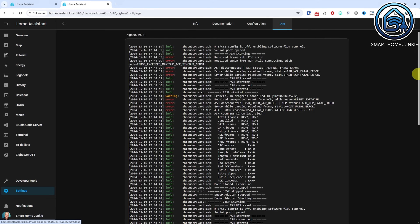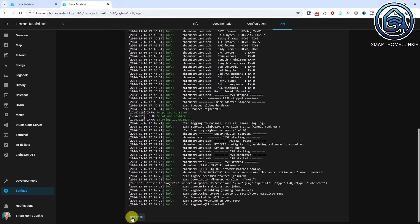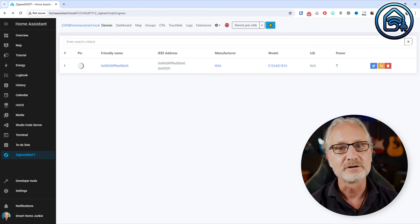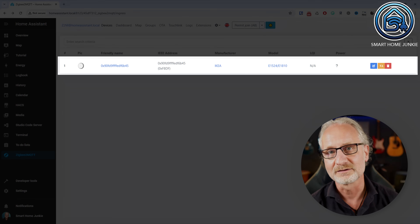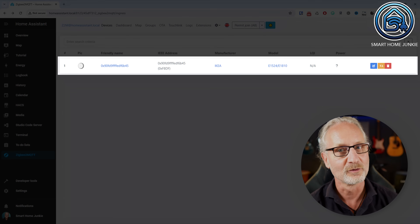Should you encounter a problem at startup, reboot your entire Home Assistant server — so not Home Assistant alone, but the host. If all went well, you will see the line 'Zigbee2MQTT started'. Now you can open the Zigbee2MQTT interface and add new devices. If you had already added devices, you should see them again here. I had linked this IKEA button with EZSP first and you can see it is still available after putting the Ember firmware on the dongle.